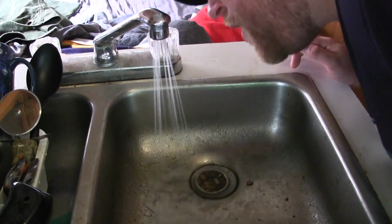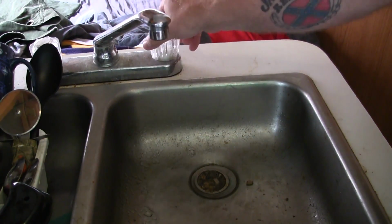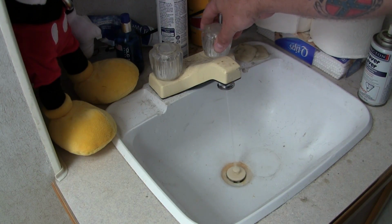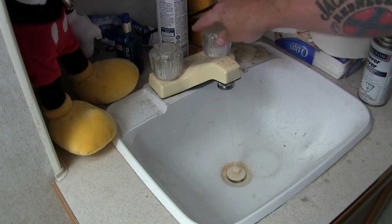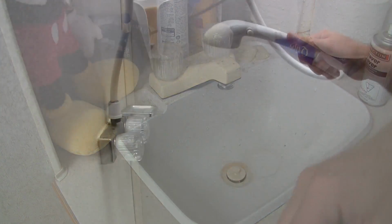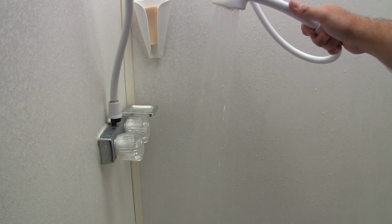Okay, there we go. I can smell bleach. We've got bleach coming through all of this line here. Turn it off. Come in here into the bathroom and do the same exact thing. Smells like bleach. There we go. Come into the shower area. Same thing. Let this run until you smell bleach.